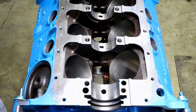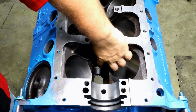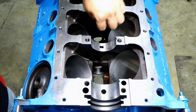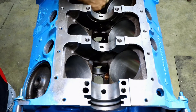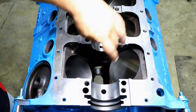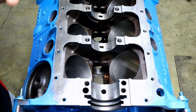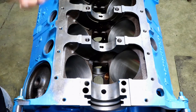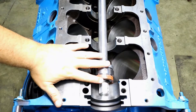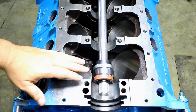Something important to note: we went ahead and marked where the oiling port or oiling gallery is on each of the bearing holes using a silver Sharpie so they contrast with the iron itself. This lets us clearly see where those holes are so we can get the newly drilled hole aligned in the proper position. This assembly is the business end of the cam bearing installation tool.